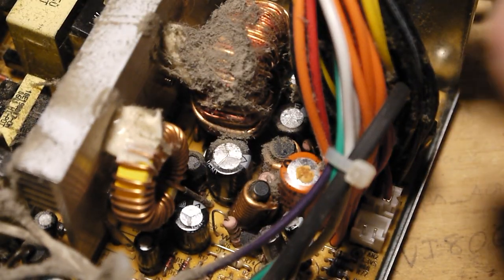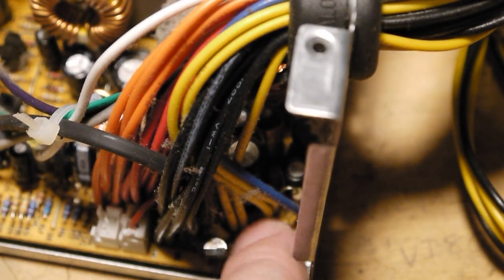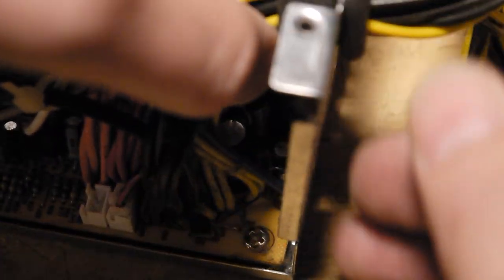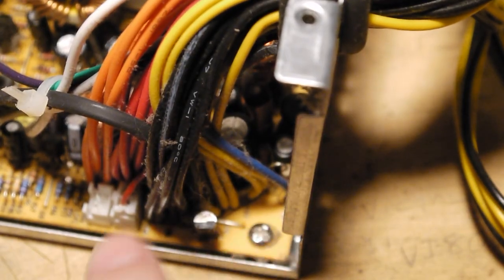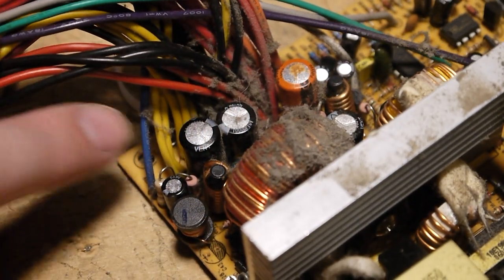There's a lot of dust in there — I've got to clean it out. All the 12-volt coming down into this area — it looks like there might be two separate sections, but it's hard to tell. Some wires are going back behind there, but they all look like they're coming from the same spot. So I think I'm going to have to actually pull the logic board out and look underneath to check the traces and find out what's going on. More disassembly, which I have to do anyway to get rid of that capacitor.